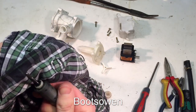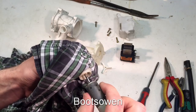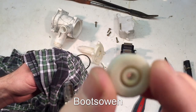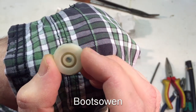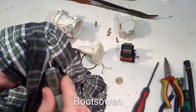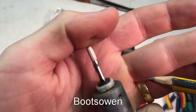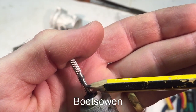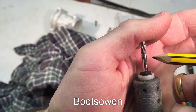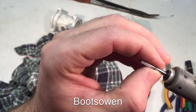I would never expect to spend much for one of these secondhand, and they are just a press fit there, but it looks like that's stoved over — that's broken on a dud now. That's stoved over, or welded over or something, but it's a one-way job now. Let's get in here and dry this off and have a look at it. There's a load of wear on this shaft. I wouldn't have thought something on a plastic bearing — because that's all that is, it's just some kind of nylon or something — this just goes in there as a bearing. The metal shaft is actually not quite as oblong as I thought, but it's definitely not circular — it's worn out to one side. You can see a marked step — from here down to here on the bearing surface it's all rubbed away on this side; there's like half a millimeter dug in, all the way around until about five eighths of the way around — more than half — it's completely polished off on that side.